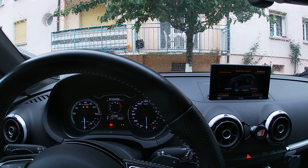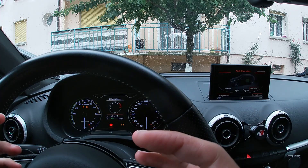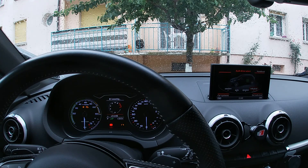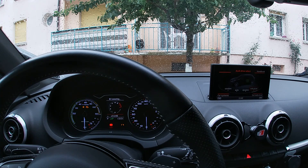I had some questions and comments where people were asking about the preheating of the engine, if there was one or not. So the short answer is: no, there is no preheating. I also demonstrated this while driving on the highway in EV mode — suddenly I had no more battery, the ICE engaged, turned on and engaged the gears directly. So I had 2000+ RPMs showing, which is technically not good for an engine.